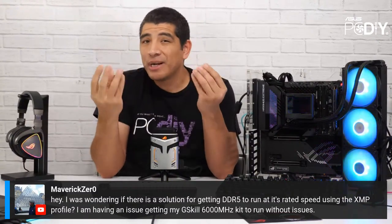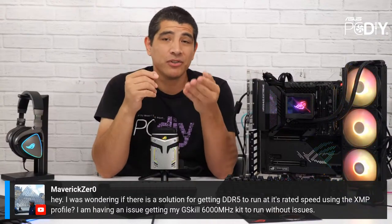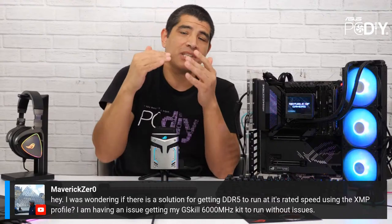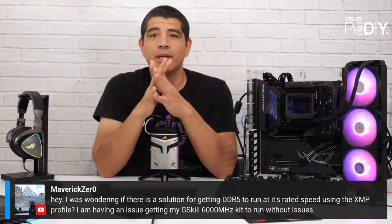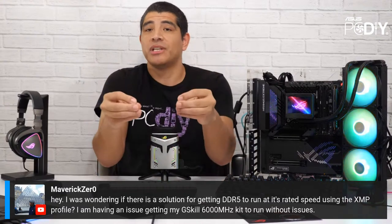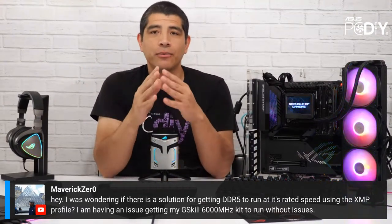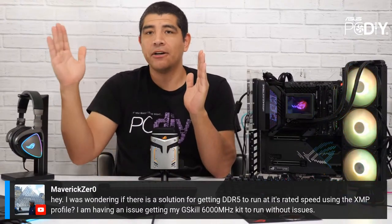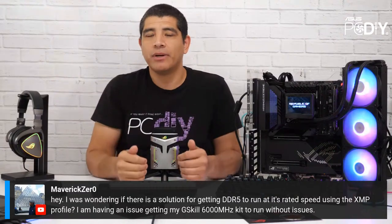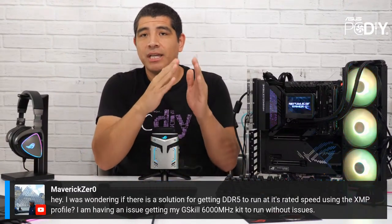Now, if you really want to try to get to 6000, that's when you can start to maybe fine tune some elements. It might mean maybe increasing certain voltage policies that might help to stabilize the OC, but it's not a guarantee. Again, you're talking about overclock related frequencies, and there is no 100% guarantee. An XMP profile is not an assurance that it's actually going to be able to run, especially as you get to higher and higher values. If you want always like 100% level likelihood of running a memory, you actually want to run closer to that original validated specification for memory.